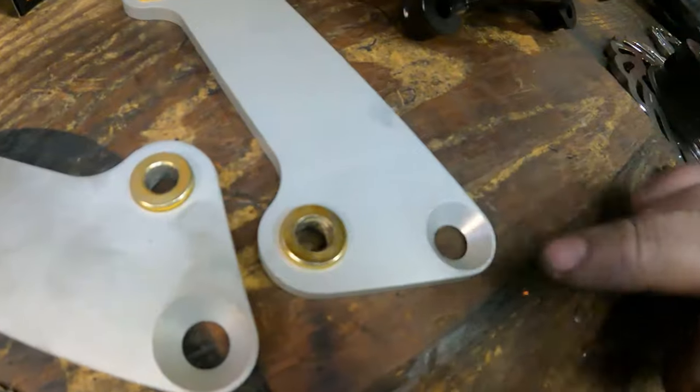If you don't have the right drill size, you could either have too small of a hole, and then you try to tap it, and you'll end up breaking your tap in your hole, which sucks, because then you got to try to get your tap out of your hole. But if you have a drill bit that's too big, then your threads won't be formed, and then your spindle's practically trash. I mean, I could drill it up to another drill size bigger, but then you got to go get another bolt, and then you got to find a pan head bolt, and then it just turns into a snowball. So when you drill and tap, you always want to make sure that you have the right size drill bit and a nice set of calipers, or just a set of calipers in general will get you the right size drill bit.